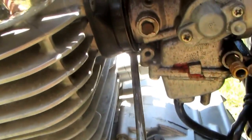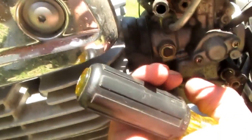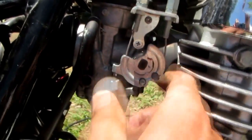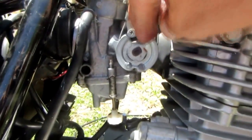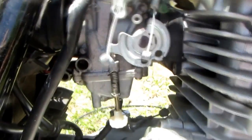We did that and the motor started right up — it idled for about three seconds. That tells me I've got a fuel problem in this carburetor. So now I'm loosening up the ring clamp on the front part of the carburetor; the back one we've already got off. Next I'll work on the throttle assembly — there are two screws on the side.